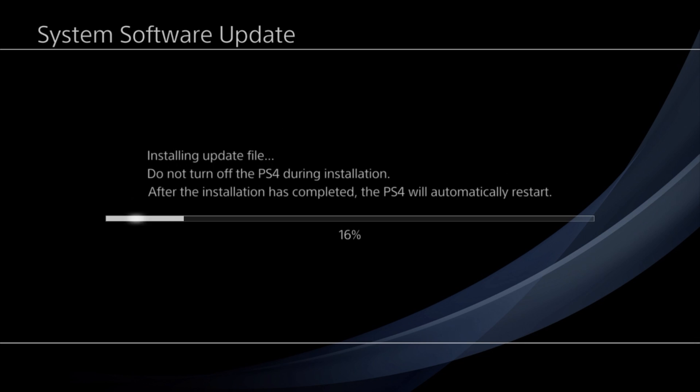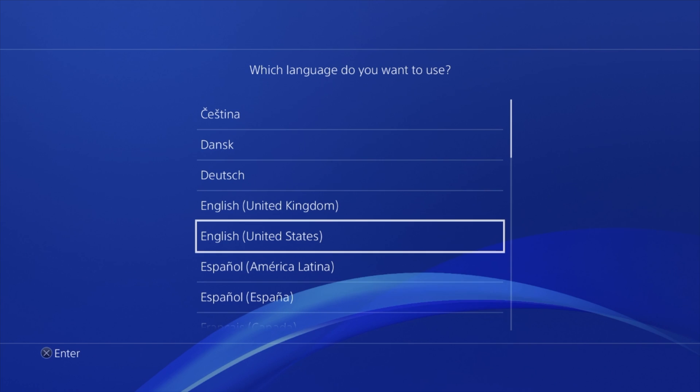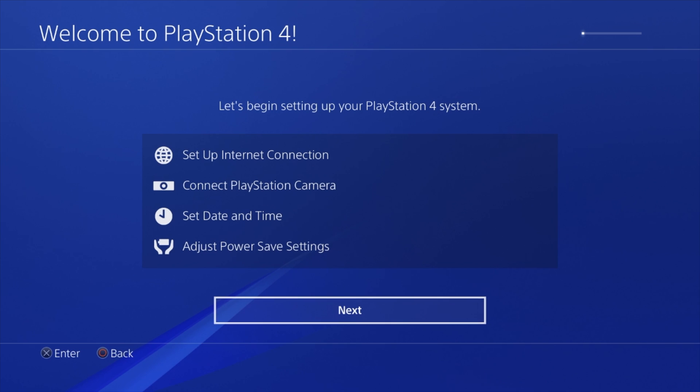Reconnect your console to power and the TV, and plug in the PS4 controller by USB. Insert the USB drive with the software and power on your PS4 by holding the power button until the second beep to launch in safe mode. When you see the menu screen, press the PS button on your controller and select 'Initialize PS4' with the X button. Your console will install the firmware you selected directly to your solid state drive. The PS4 will reboot several times during installation — don't interrupt it and don't cut power. You'll then be greeted with the original initialization screen, just like setting it up fresh out of the box.